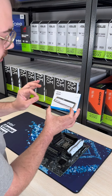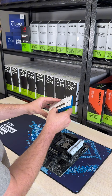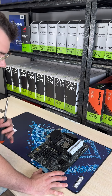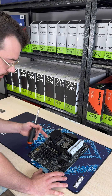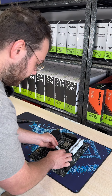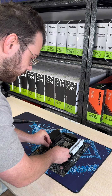Moving on, we got the Team Group 2TB M.2 SSD. It's a phenomenal SSD for the price — it reads up to 5,000 MB per second and it does come with a five-year warranty. With these motherboards, you will see an M.2 shield right here; this is to cool it down and keep the temps pretty good on your SSD. If it's your first SSD, you definitely want to plug it in here. If it's not, then you can add it in as a secondary right below. We go ahead and put that SSD right in, secure it down with a little holder, and add the shield right back on.